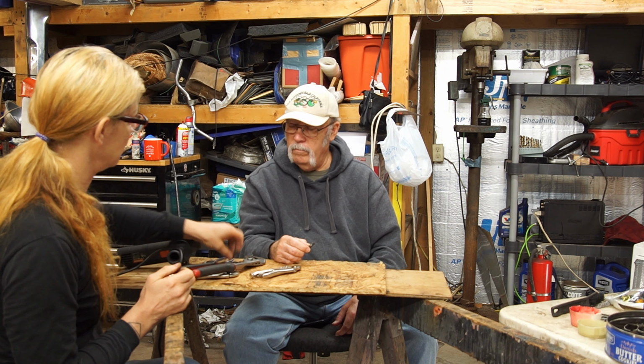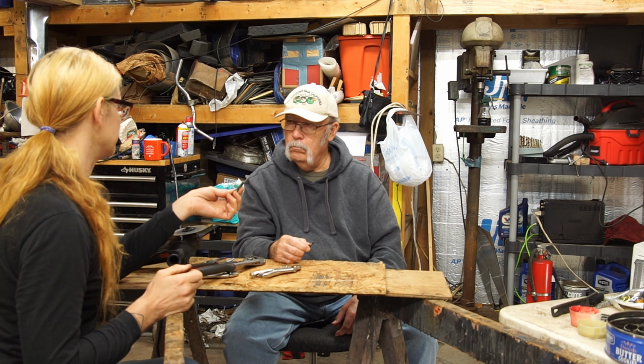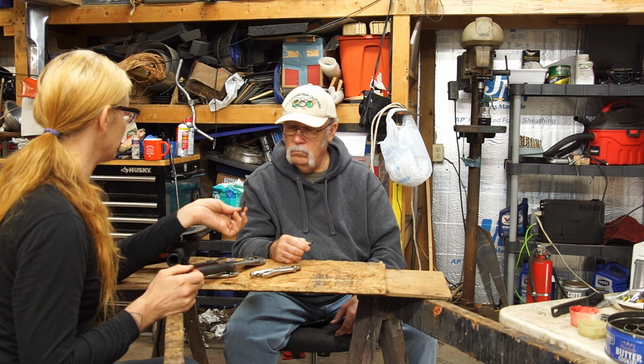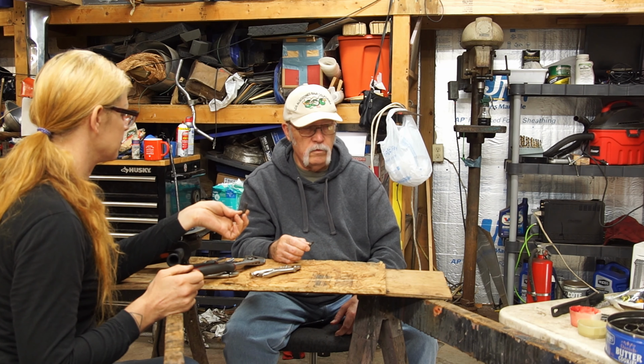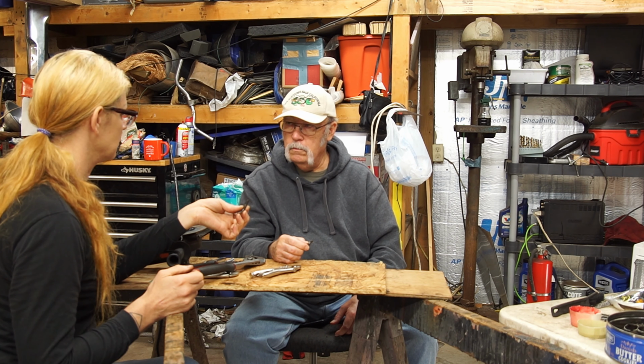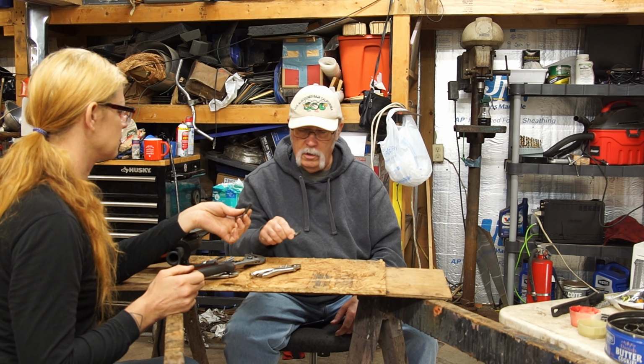You replacing them? To remanufacture that head, all the hardware has to be removed, because that's a machine surface that has to be cleaned properly. So you have to remove these to clean that machine surface. So all these have to come out. They have to come out, yeah. Okay, so now I know what I'm talking about.